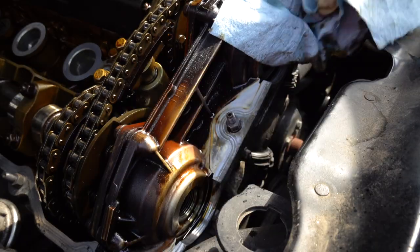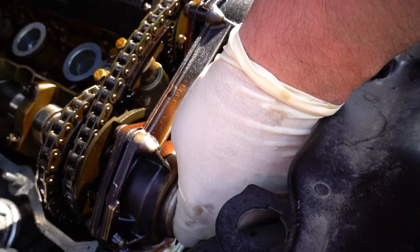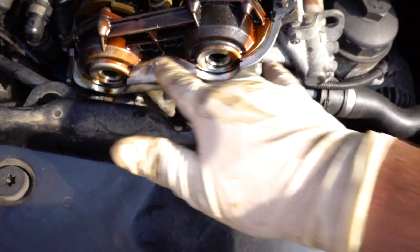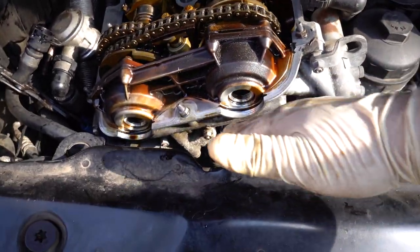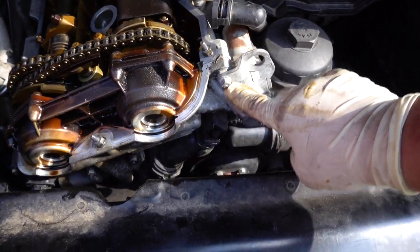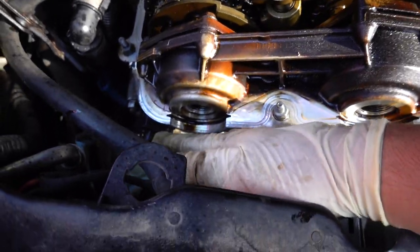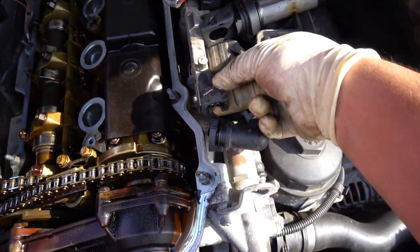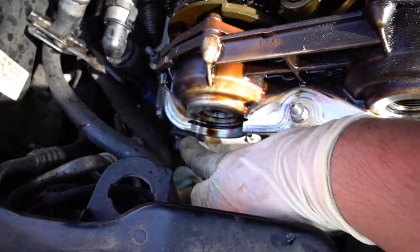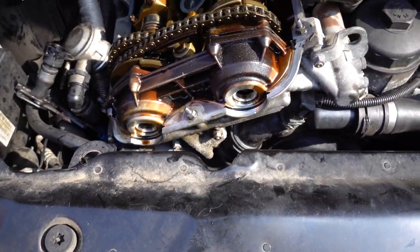There is so much oil — I was not expecting all of this. Go ahead and take it out by hand. Now that both sides are taken care of, we can take the whole assembly out. We have to take a bunch of little 10mm bolts out, this one is an 11mm, and the one on the bottom is a 13mm. Then we have to undo some connectors — I think it's three of them.